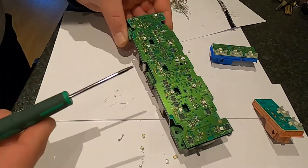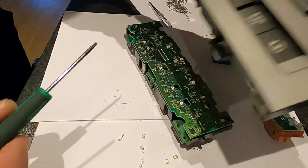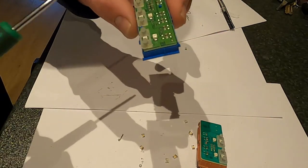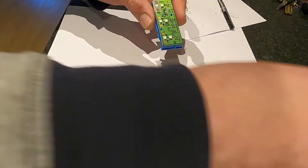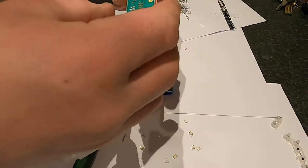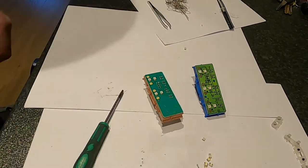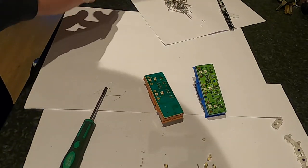All of the LEDs I wanted to replace on the main board have now been replaced. I left the side ones because as I said, for the hot and cold controls, even if you change the colour of the LED it's not gonna stand out anyway. So the first thing you want to do now is remove these little things here and put them to the side. You're now left with two sections of buttons and basically 10 LEDs to replace. Crack on.